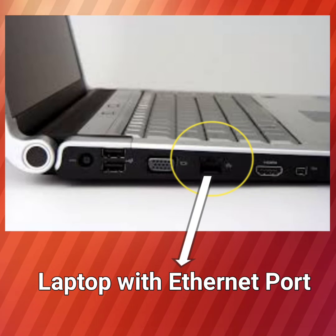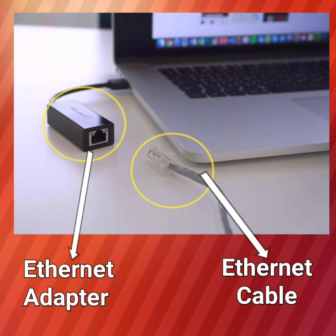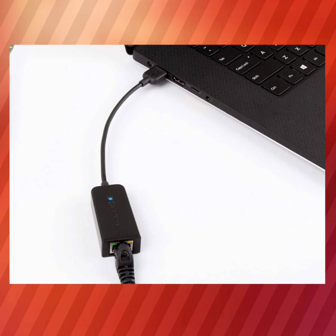How would you connect? Did you think of it? Do not worry — I am telling you a simple solution, however it will cost you some extra money. There are USB ethernet adapters available in the market; you can purchase them offline and online. Simply connect the USB end to your laptop and the ethernet cable to the ethernet socket on the adapter. Now you are good to go. I hope this information will help you use a LAN adapter.